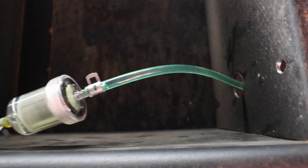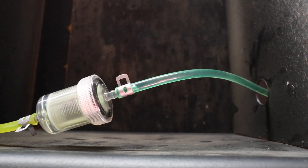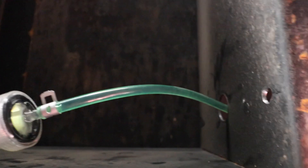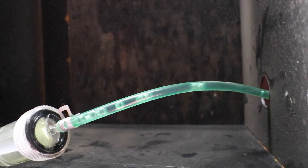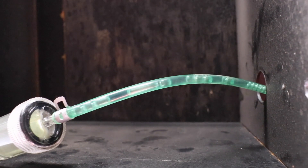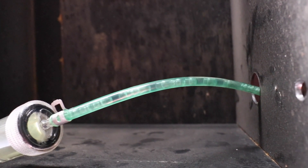I can see the air bubbles traveling in the right direction, but it's going to take a couple more primings to get the thing going. I'm going to go outside and show you what's going on with the fuel moving through there. Now you can see the fuel pump and the fuel bubbles going quite aggressively. The fuel filter is about half full and probably about ready to go. You can see air bubbles going up into the heater up here as well. I'll prime it a couple more times to get all the air bubbles out and get solid fuel going through.